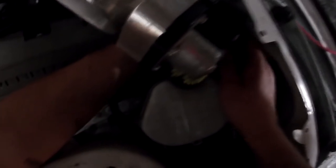Now we've got to mount our bleeder to the firewall. I'm going to go right about here on the cowl so it'll be right next to the master cylinder and be higher up to get a good bleed on it.